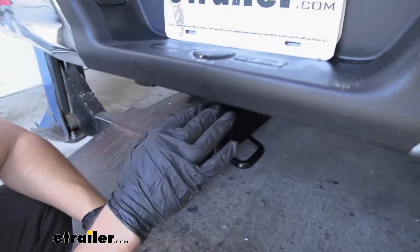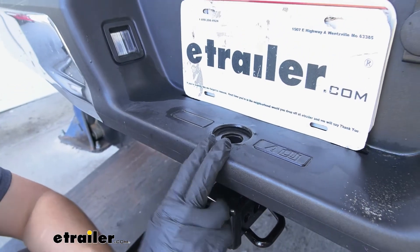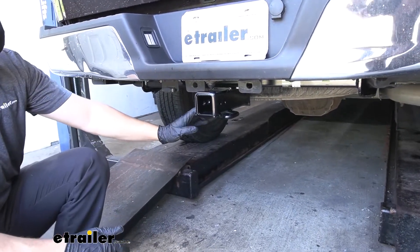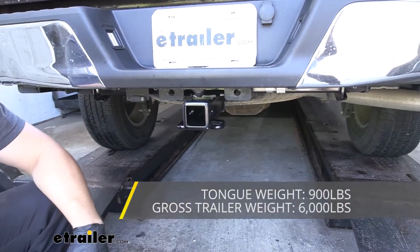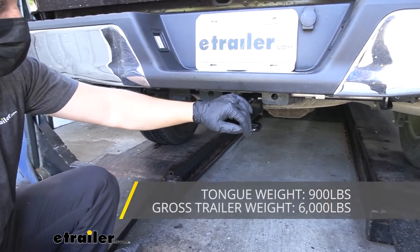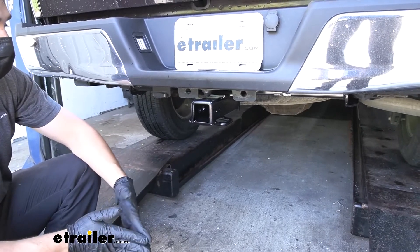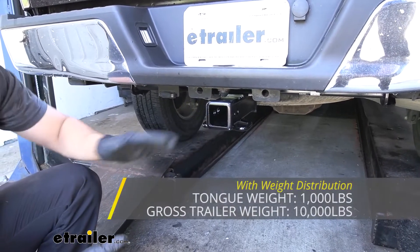What I would like to point out is that the factory hole in the hitch bumper — you're no longer going to be able to use that. But that's not a bad thing at all, because towing with the bumper really isn't ideal since you have a fixed hitch height. In regards to towing, our trailer hitch here is going to provide us with a 6,000 pound gross trailer weight rating — that's the amount we can pull with our fully loaded trailer. It also has a 900 pound tongue weight rating, which is the downward force on the receiver tube. If we have a really heavy trailer, we can increase these capacities by using a weight distribution system — we have plenty of those to choose from at etrailer — increasing the capacity to 10,000 pounds and 1,000 pounds respectively.